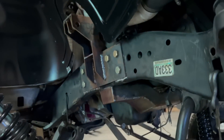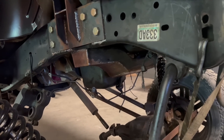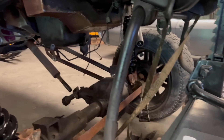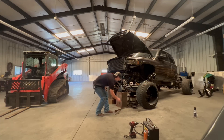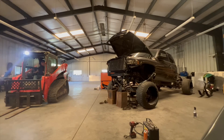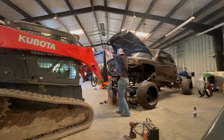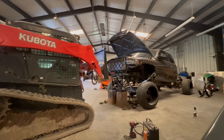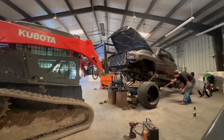I've got my hardware ready to put in the top and the straps ready to stabilize it - if I don't, it would try to move one way or the other when I set it down since it doesn't have a sway bar to keep it centered. Let's hop back in this skid steer, lift it up, and hopefully we have enough diesel to get the job done. Just like that, with the help of the Kubota, she is back on the ground.